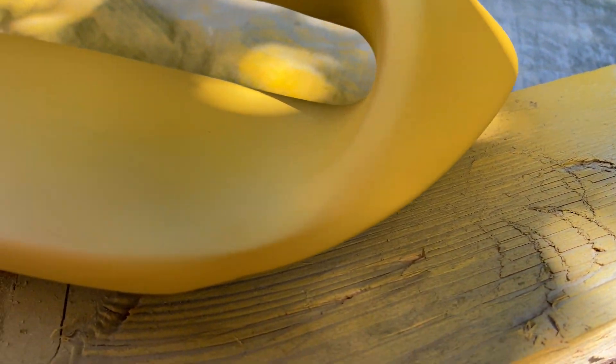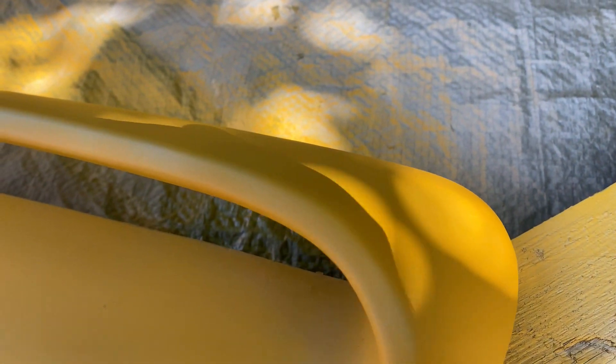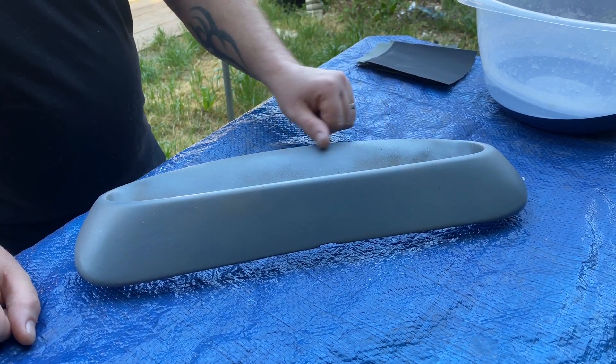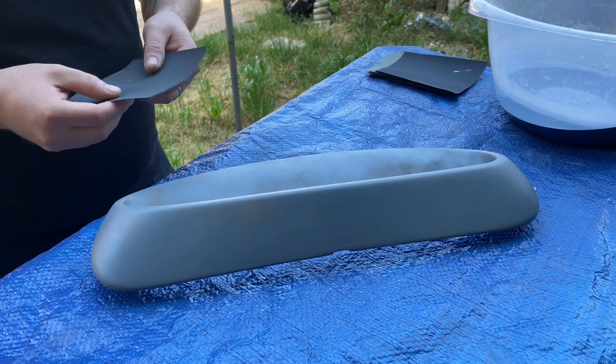You can see some of it's still a little bit grey where the original primer is showing through. The first coat is always a tack coat - just a very thin layer to give it more adhesion. I'm going to give it a couple more coats of yellow filler primer, then spray some grey over the spots that still need coverage. When it sands back down to yellow, I know it's been made good. I did four coats of yellow filler primer, then two light coats of grey primer to give something to sand down into. For the final pieces I'll wet sand with 800, then go all over it with 1200.